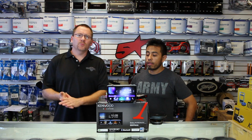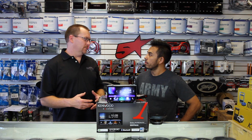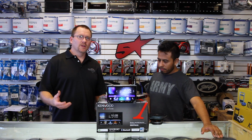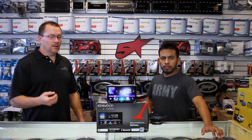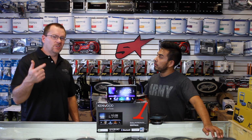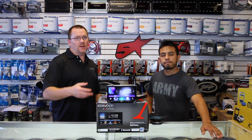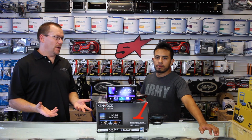For those of you unfamiliar, iDataLink is an interface company. A lot of the times in modern cars, they don't just take a standard wiring harness. It's not just plug and play. Things like air conditioning, tire pressure, general setup on the car, whether it's got a tow package or not, gauges are set through the factory radio. And you need a way to interface with those in order to replace your radio with an aftermarket one.